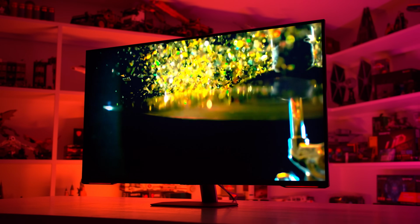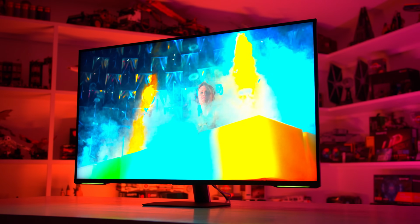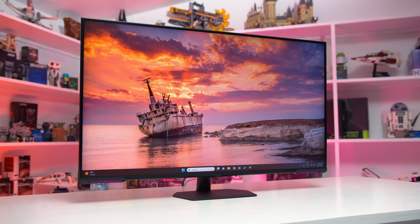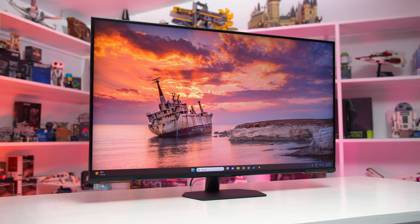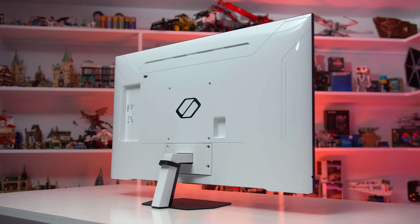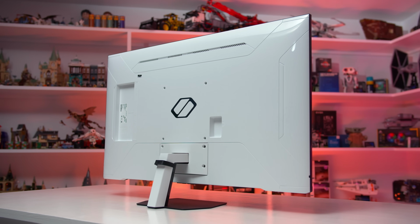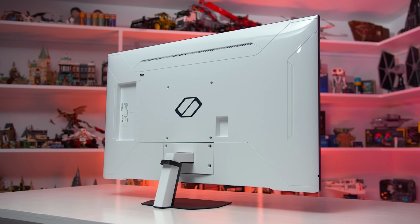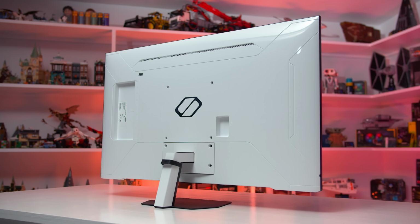The LS43 has other strengths for productivity work and general color reproduction. It has a nice high native contrast ratio, wide color gamut, great brightness, and the Smart TV processor provides significant scope for hardware calibration. It is let down somewhat by poor viewing angles, which do affect the corners of such a large screen at desk viewing distances, but there's a lot to work with here when response times don't get in the way.